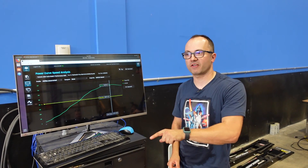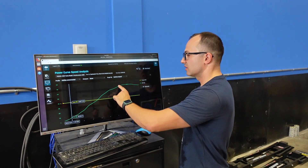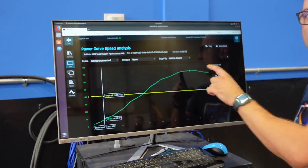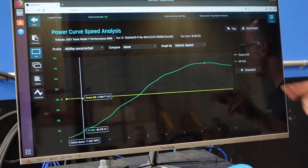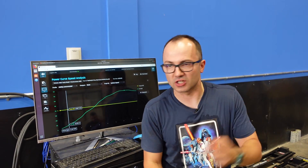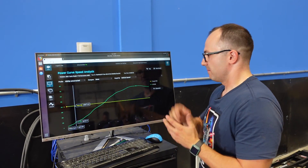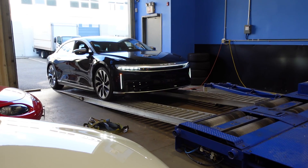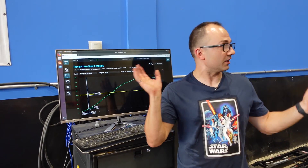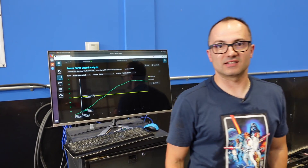But it was super cool. This is our second electric car on our dyno. We had a Taycan in here, and the Taycan as well as this car exhibit very similar curves where the torque hits super hard down low — that's when you feel your chest compress under acceleration. But as you approach the 100 mile an hour point, you can see the power curve is already dropping, simply because there aren't that many gears. I think this car has only one gear; the Taycan has two gears. There's nothing to gear up from the motor, and the back EMF on the motors starts to take hold and reduce the output. Super neat — I hope you guys enjoyed seeing this car. I do think this is a world premiere, a world first of someone strapping one down. If you've got any other electric cars, Lucid or otherwise, bring it on down and let's see the differences. Thanks again, Linus, for bringing the car in — we'll catch you guys in the next one.